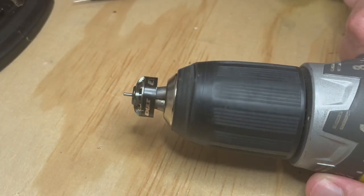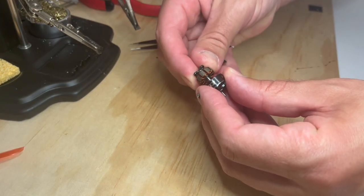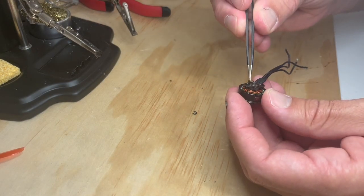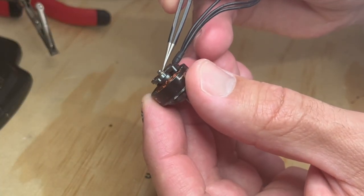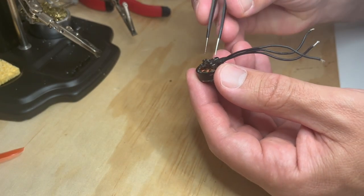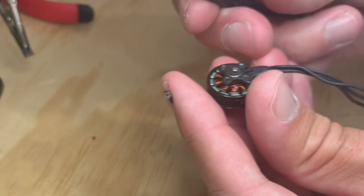As you can see, I've gone through the steps a couple of times — bending it, spinning it to see what it's like — and that's the final result. Then reassemble the motor. Place on the pesky little washer that I almost lost. And then place on the C-clip. This is arguably the hardest part of the whole process. I simply put my thumb behind the C-clip to ensure it doesn't fly off if it rebounds, and push through the direction of the opening until I hear a click.